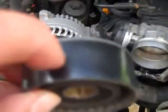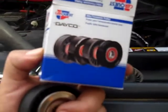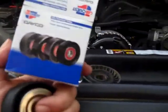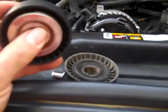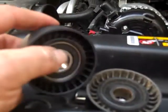Here's the removed pulley — this is one of the smooth pulleys. There are some idler pulleys that are grooved. We'll take the new idler pulley and put the 13mm bolt back on, and reroute the serpentine belt. I've got this CarQuest part from Advance Auto — I always use Advance Auto, not sponsored, they're just near my house. Anytime you buy from their website you get a 20-30% discount using promo codes. The replacement pulley comes with dust covers, but the instructions say it has sealed bearings so dust covers are not required — and there were no dust covers on the factory one.